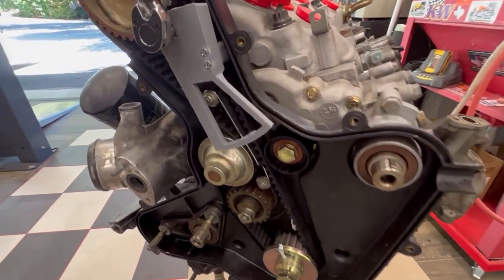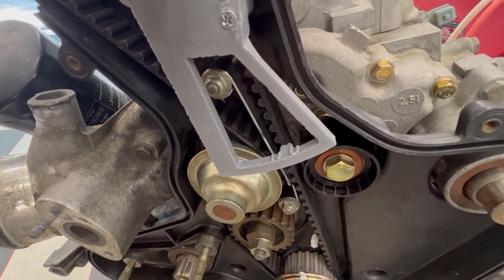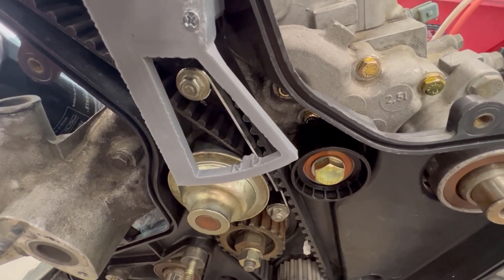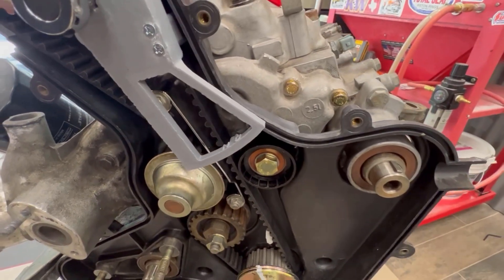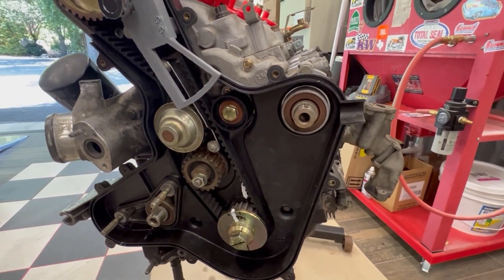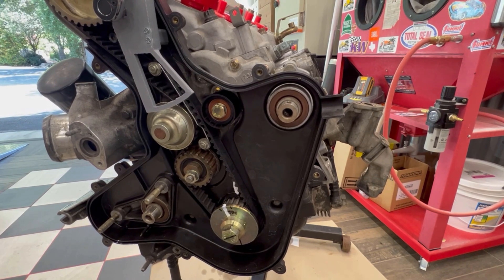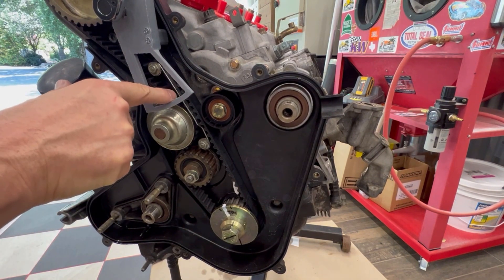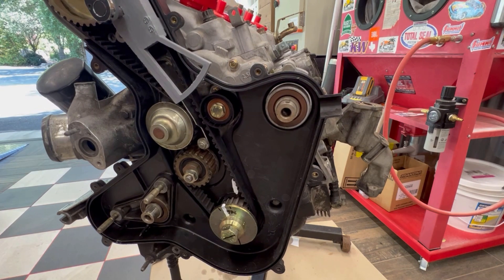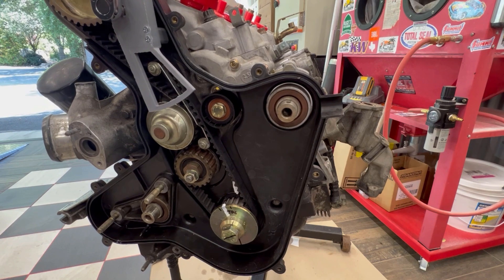You can see the U and the pointer. When it crosses the water pump guard rail there, it clicks at 7 foot pounds. And because it's lining up with the guard rail on that pointer, that means it's set to the spec for a used belt, which is 2.7.